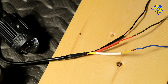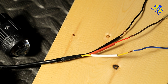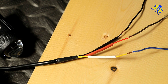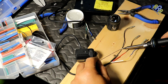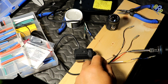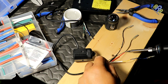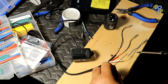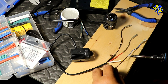Again, this is the wire color coding of this second driving light slash turn signal light. Now time to solder – and don't forget to put the shrinkable tube on first. After soldering, heat the shrinkable tube.